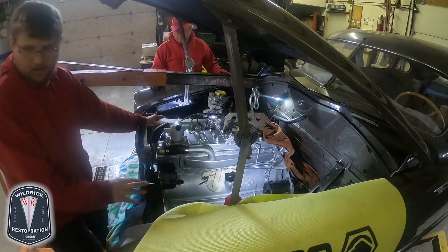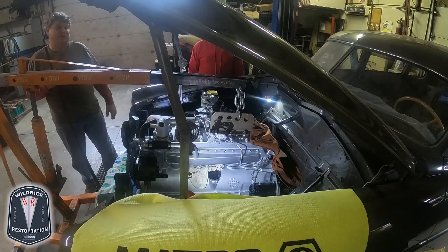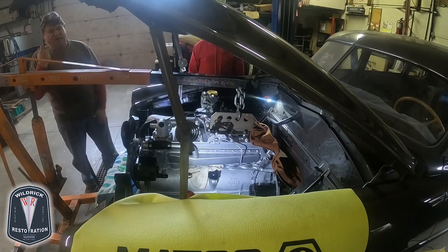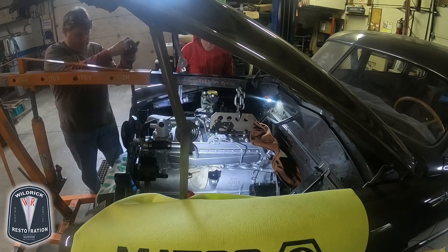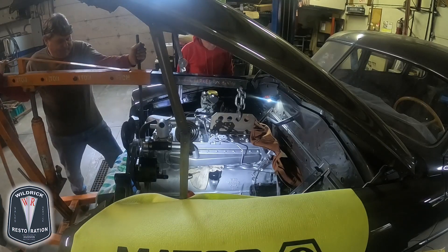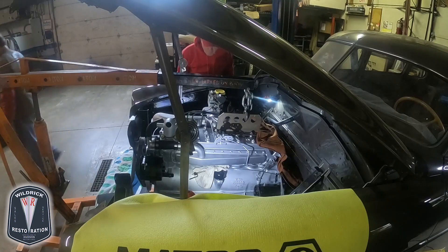I'm trying to give it a little help with the bar. The floor pan is still in this vehicle — we decided not to take it out because we didn't want to disturb the original rubber floor mat in the front. This is a '49 Commodore. We just need to pry slightly here off the engine support plate — not the damper — and it should go right in. Wiggle that a little bit. Just like that, it's over the hump, so now we should be able to direct it right in the hole.